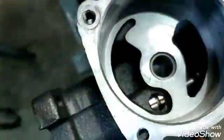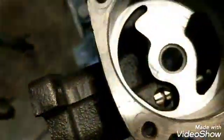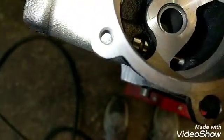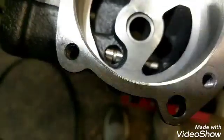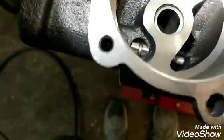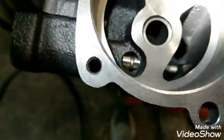That little step right there where the piston rides on — don't take that out. It'll still work, everything will be hunky dory, just your oil pressure won't be as high as normal would be. I did that on the cobra, so like everything, sometimes you make mistakes and you learn from them. So I'm not doing that no more.